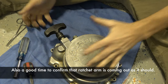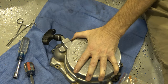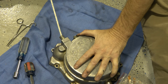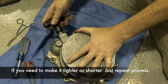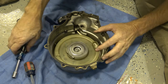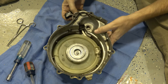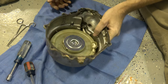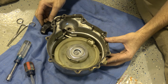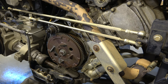I'm going to keep pressure on the wheel to keep it from spinning, hold the rope, and just let it wind itself back up — I think that's pretty good. It fits on there nice and compressed. If I pull it off it goes right back to where it's supposed to. You can wiggle that on there and I could pull way more than I need to to start this thing. That's pretty much it — it went pretty well. I can see where a lot of things might go sideways if you start taking everything apart, but my goal was just to replace that handle and rope. I'm going to pop that back on the machine and maybe give it a pull.